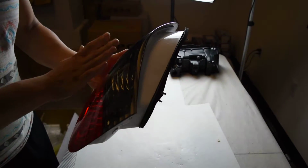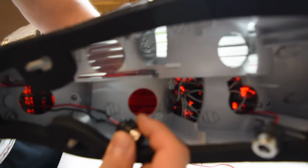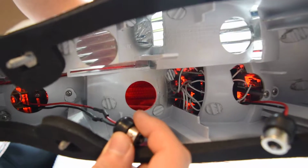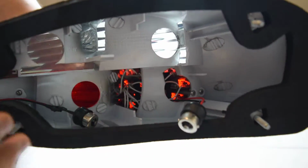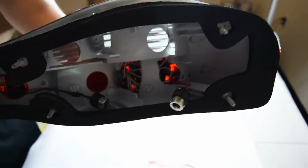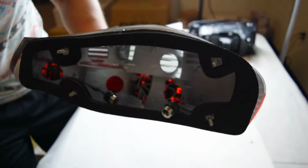Afternoon. This video documentation is in regards to the addressed Force Box taillight. Glad to confirm with you that the driver-side taillight you returned to us, my mechanic did an awesome job repairing the wires. So confirming with you that he's actually soldered both wires, with heat shrink right over it so that it has a solid connection. I'm actually going to take the time to re-bench test both LED connections to show you that the rear fog lights and the brake lights are indeed working with no problem.